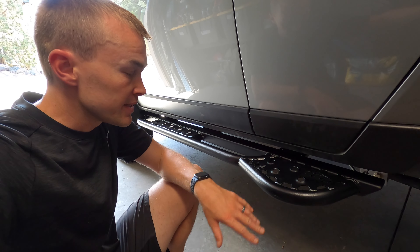For the install, I placed a piece of cardboard on the floor jack, centered in the middle, to protect the powder coated finish. Rest the slider on the cardboard and get it nicely balanced on the floor jack. Then line up the holes with the mounting plates, repositioning the floor jack as needed. Once lined up, raise it up into position. Grab your hardware — with eight holes, get all eight bolts lined up before tightening any of them to make sure everything is aligned correctly. Then tighten in a star pattern, going back and forth between positions so the front doesn't get over-tightened before the rear, then torque to spec.